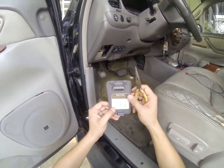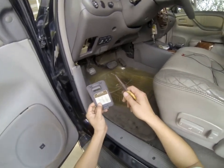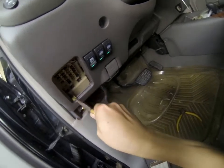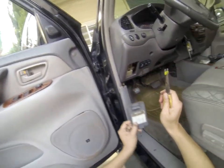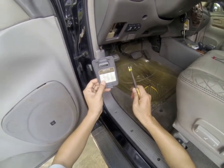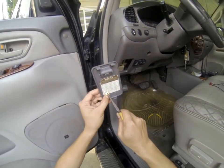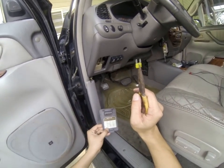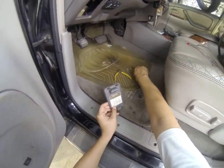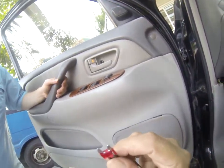Now I try ignition 2, IGN 2, which is 20 amp. Oh. Now, see, I'm right. Second try, a success. I found the ignition, which is ignition 2, 20 amp, this fuse. Okay, now leave this fuse and use this connector.